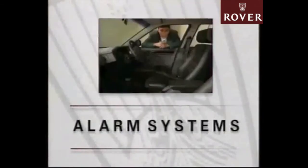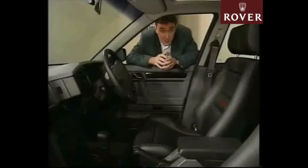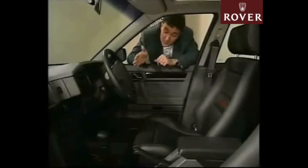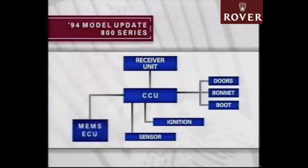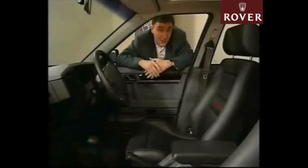We'll now take a more detailed look at the 94 model year 820 system, which is slightly different to the systems used on the 94 model year V6 and diesel models. The components that make up the alarm system are pretty much the same as before. The CCU still controls the system, linked with the receiver unit located just above the rear-view mirror, with all the various door, bonnet and boot switches, the ignition switch, the ultrasonic sensor at the top of the left-hand B/C post, the horns, the alarm LED, and now also linked into the MEMS ECU. Because operation of the ultrasonic system is now controlled by the way the vehicle is locked, there's no longer a need for the ultrasonic disable switch, which was fitted at the top of the right-hand B/C post on earlier cars, so on 94 model year cars you'll no longer find that fitted.